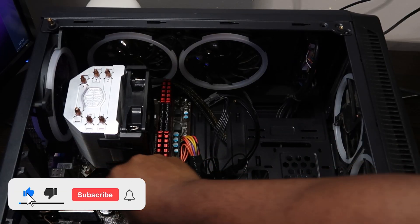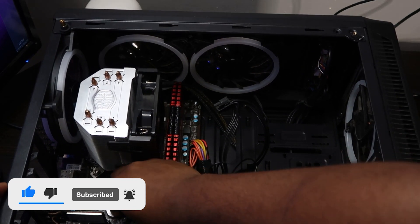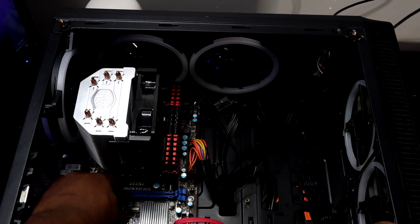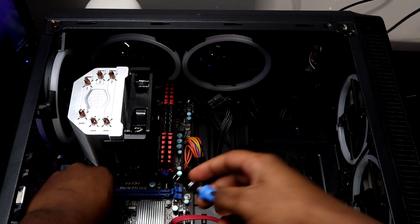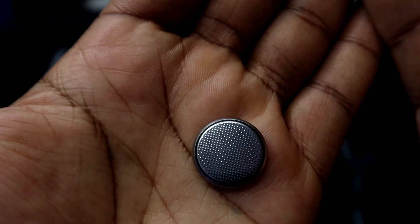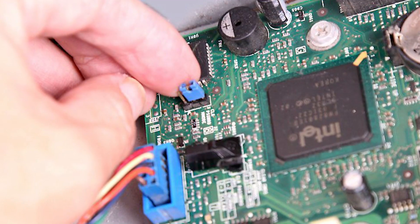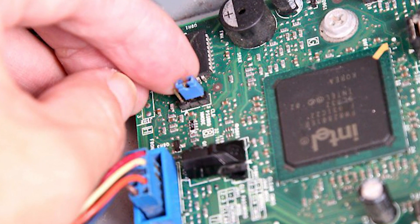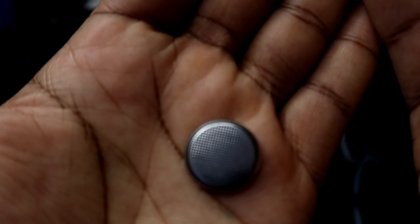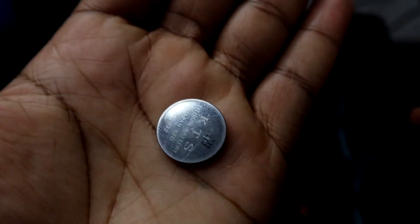One of the first things you can do before you even remove any parts is lay your PC to the side and reset the CMOS. This is a very old motherboard — an i3 board. For old boards you just remove the watch battery and that will clear the CMOS. Other boards have a two-pin switch you can move and hold the power button for about 30 seconds to reset the CMOS as well. Replace the watch battery, put it back in, and hopefully when you press the on button you should get some life on that monitor.